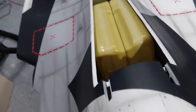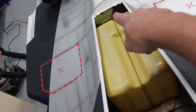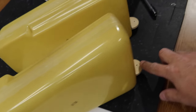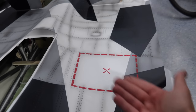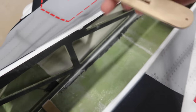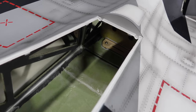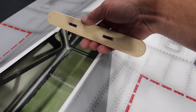I vacuumed out the back end — there was a little overspray paint dust throughout. With the front end off we have great access to the nose gear. We'll pull all the allen key bolt fasteners and also remove the main tanks. The two front tanks and back tank come out, and the design is quite clever — the back tank exits through a specific opening, so that piece is designed to be removable. It's a really well-thought-out design.